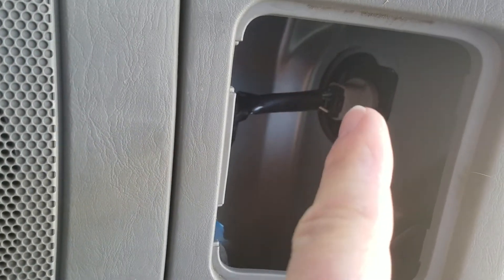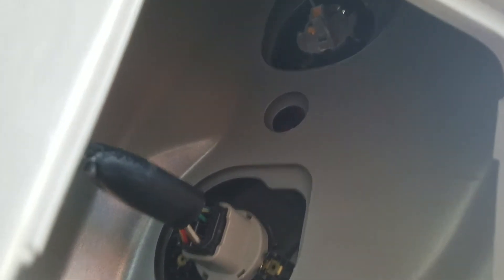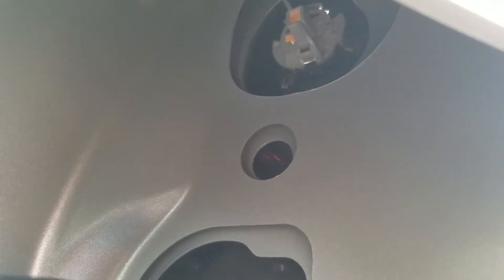This middle one is going to be your tail light, and if you look up, there's another light housing right there — that is your turn indicator. To get it out, we're going to grip the edges of that. You see those little tabs on the bottom and top — we're going to grip those and give it a twist in the counterclockwise direction, about 15 to 20 degrees.